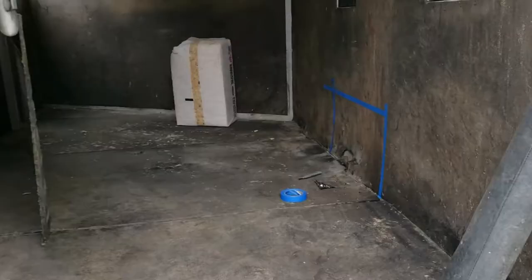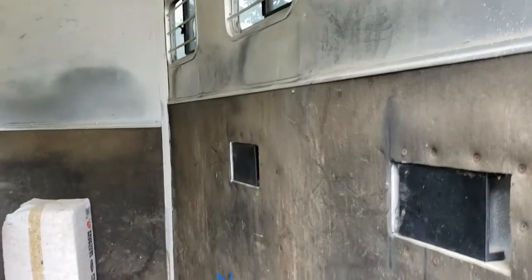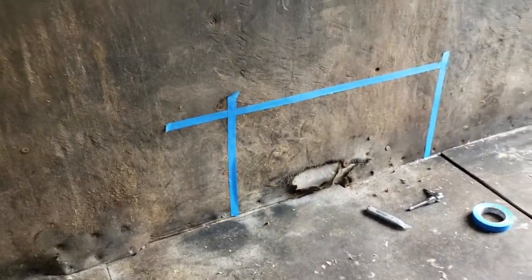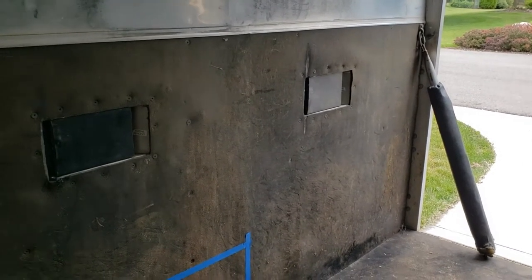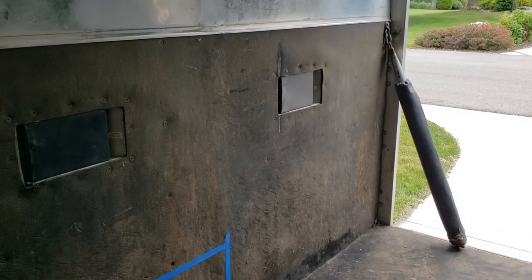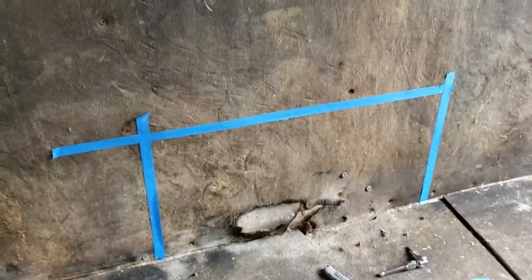Let's take a look at one more issue that we're dealing with. You can see this has a 4 foot pad all against the wall there. Hard rubber, 3/16 of an inch. And over the years, that's gotten kicked and scuffed and whatever, and now it's torn. So what we're gonna do, this material, you buy it in either 2 foot tall sections or 4 foot. Well, this is obviously 4 foot. We don't want to replace this entire wall because it's about $13.50 a running foot for the 4 foot, and it's about $10 for the 2 foot. So we're just going to start with this one by cutting a patch for it.